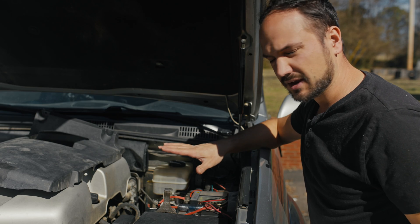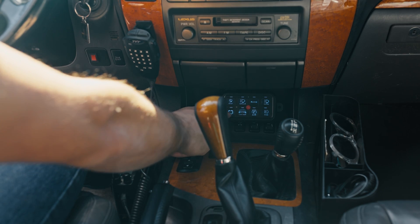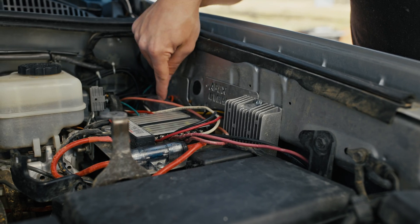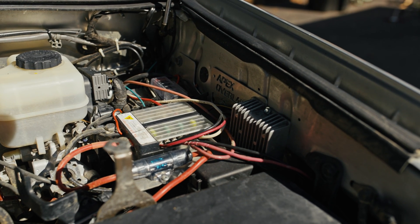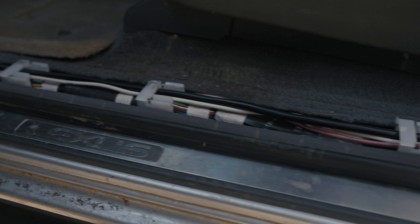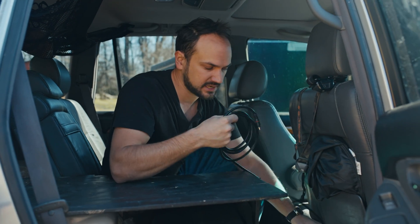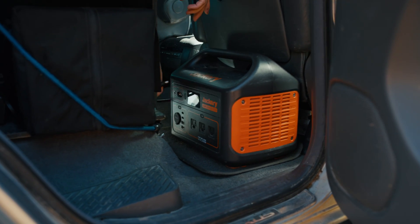Just a brief overview of how I have my electrical setup under the hood of my GX: I'm running an aux beam switch panel, one of their older models. One of the circuits goes to the 12-to-24-volt converter, and from there I'm running out of the converter to a secondary four-circuit fuse block. This keeps the 12-volt and 24-volt circuits separate and lets me hook up a few more 24-volt systems in the future. After coming through the firewall — pretty easy to pop up your floor trim and route your cable to the back seat — I bought the 20-foot extension cable. You can get it in 30-foot, but honestly 20-foot is plenty long enough. Currently I just have the Jackery right here in the back seat behind the passenger seat with the extra cable coiled up underneath the seat, plugged in like so.